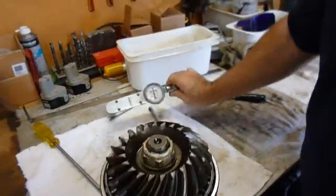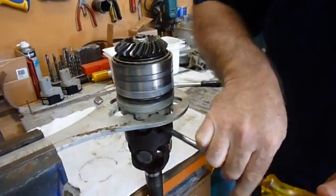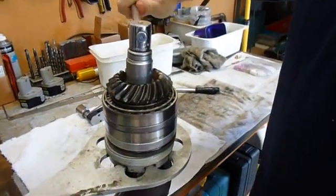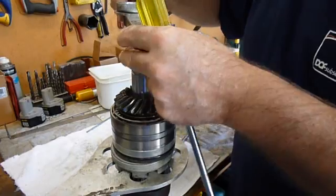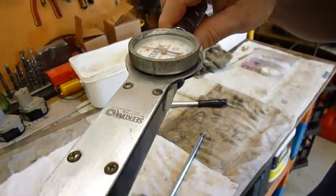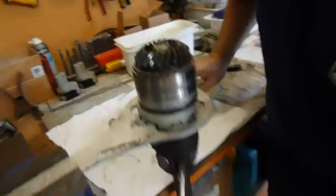So what we do is very, very carefully put a screwdriver through the yoke to lock it, and then carefully tighten the nut slightly — very, very slightly — and then check it again. I got lucky, that's now two and a half, needs a little bit more.